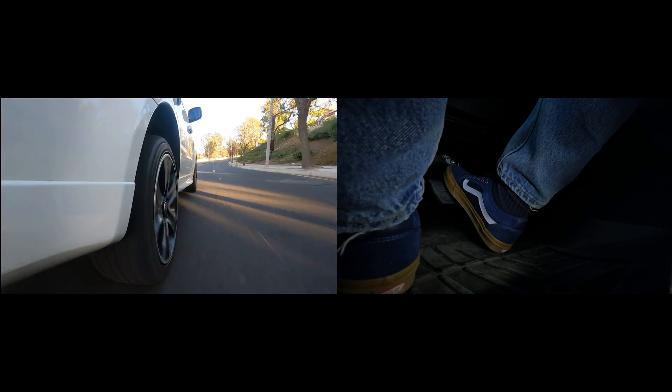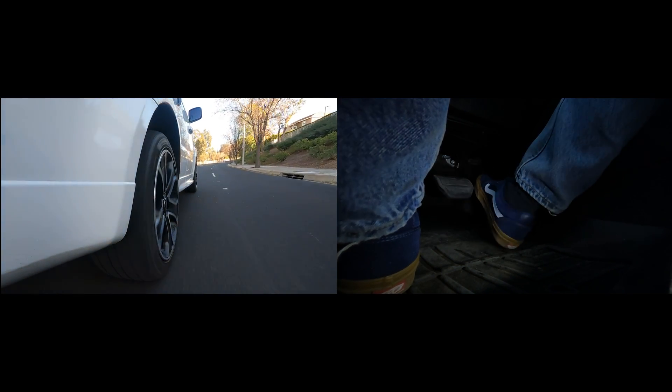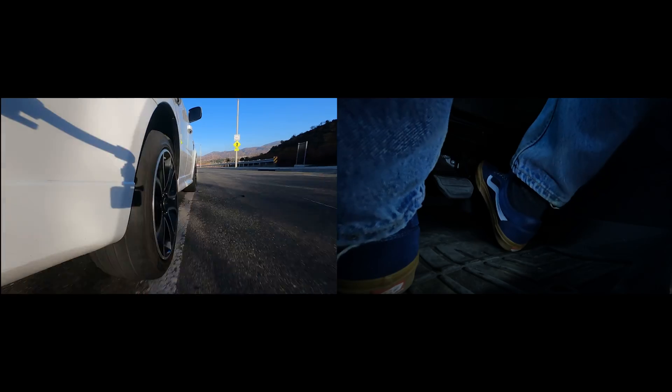See how high up the pedal grabs? That's what I wanted all along. For a year I've been driving this and, again, it functioned fine — I just knew there was something off. I had this problem about six, seven years ago with my Jeep. The redneck way of doing what we just did today is to go out to a dirt road and hammer into the ABS by just slamming on the brakes, activate the pump, run back home and bleed it again. And that actually worked — but I do not recommend that as the right way. What we just did is the right way to do this.